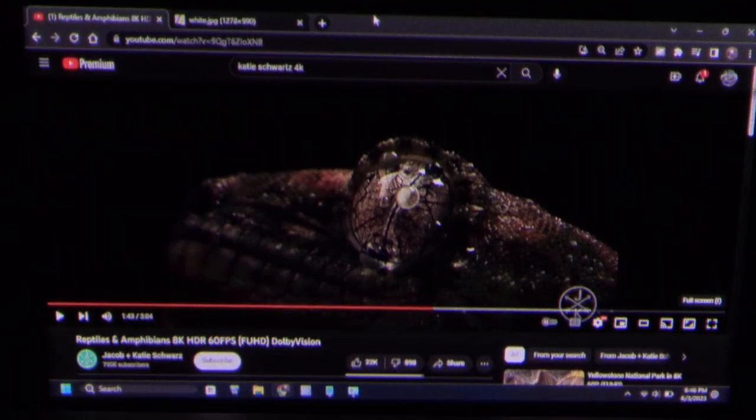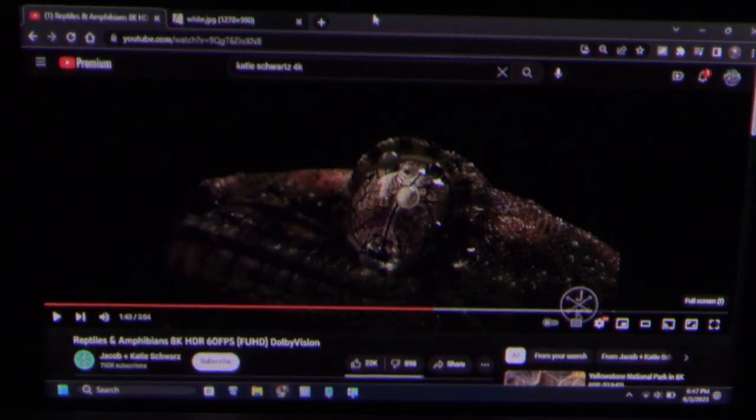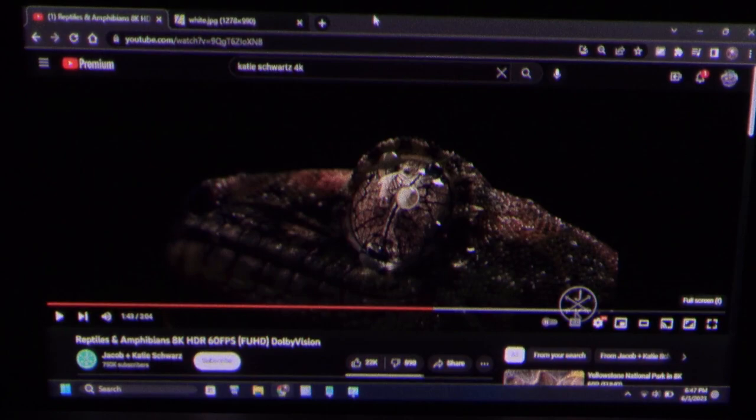One other artifact I found interesting, which was very analogous to a CRT that doesn't have the best high voltage regulation, is when you switch from a dark image to a bright image, the size actually changes a bit. It expands horizontally when you go to a very bright or all white image like this. And I assume that's something to do with the little MEMS mirror being heated up and distorting a little bit, but I'm not 100% sure. It was just something I found interesting. It's really not something that's noticeable in any sort of normal use, or at least for watching content.